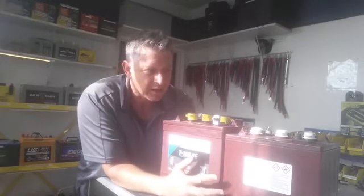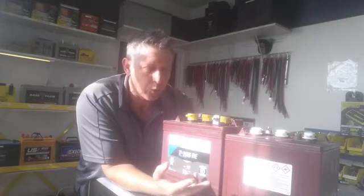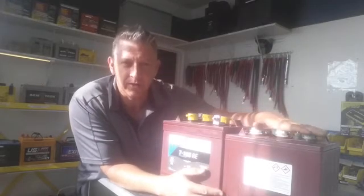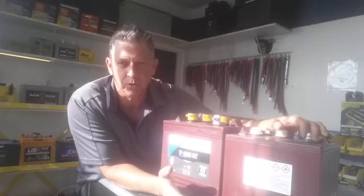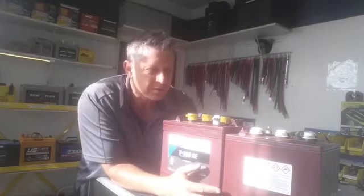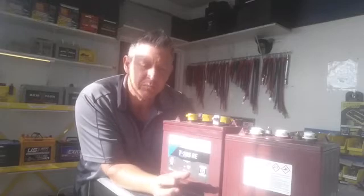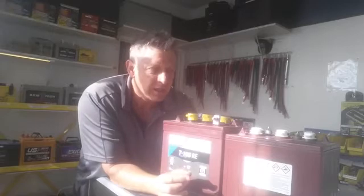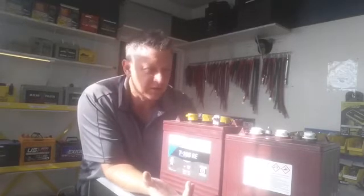Trojan has employed pretty much a three-fold technique in quality of manufacturing to separate themselves from the competition. You would find a Trojan Battery if you go to a golf course and lift the seat up on their golf cart fleet — you're going to find Trojans. You're never going to find a Costco Battery there because the Trojan Battery uses a MaxGuard plate separator. That keeps the plates from shorting out. Over time, the plates are going to compress and decay. This is going to keep the plates from touching and shorting out. The Costco Battery is going to fail — it's got a very general purpose plate separator and it's going to fall apart in a couple of years.